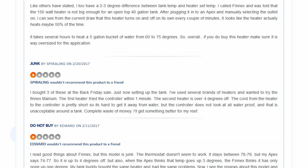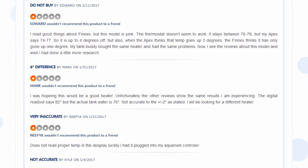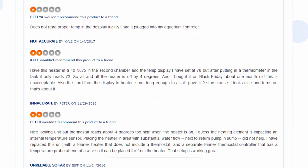That said, the HMX has one of the worst series of reviews on our site and only 2 stars, and we almost considered pulling it because of that. However, after reading some of the reviews, I think a lot of them are related to that issue of the thermostat being incorporated into the head of the heating element, which causes it to heat up much slower, and while it's heating up, to over-display the temp. However, once it reaches the desired temp, it will be pretty accurate.